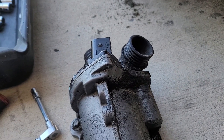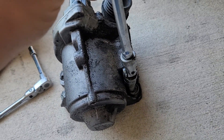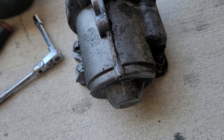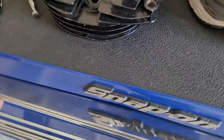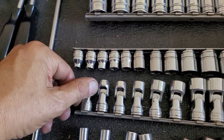Let's cover this first. You're gonna need that E12 like I said to get to the top bolt right here — it's kind of a pain. I use a swivel like that. I don't know if Snap-on makes a swiveling E socket, you know what I mean? Something like this but with the E style on the end — the reverse Torx thing. So if you've got that or you want to look for one, it'd be a little easier and give you a little bit more clearance underneath.